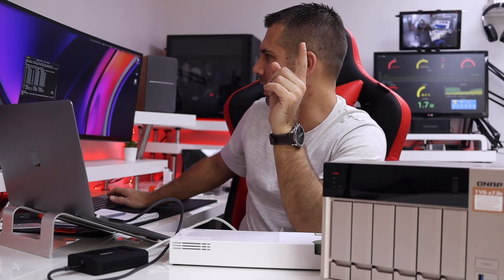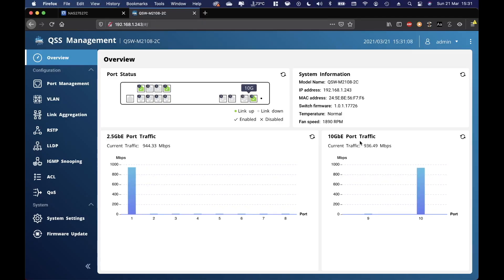Let's do a test of a one gigabit machine — I've got my Mac Mini here with iPerf installed. On the switch menu we are getting one gigabit connectivity: it shows 900-something, 1000 megabits, 600-something, and then zero when the connection drops. I just want to establish a pattern to help understand the values we'll see later. This is gigabit connectivity — no surprises, something we've had for quite some time.